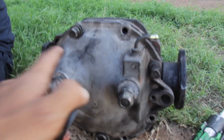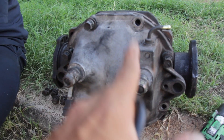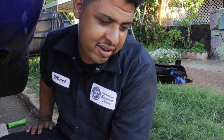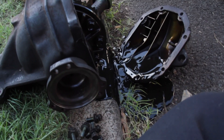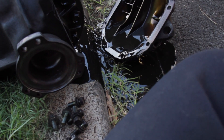So we're going to take off all these bolts around the diff — already got started. Pull off the cover, reseal it, and refill it. You might want to grab a new seal too — it'll be safer. Let's see if some juices come out. It's kind of good we took it out — that's really dirty.